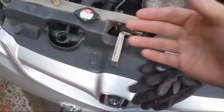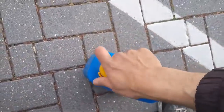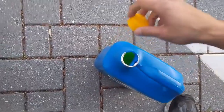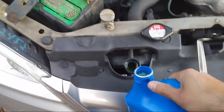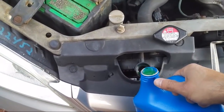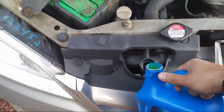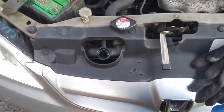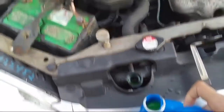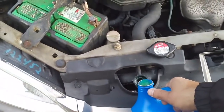I'm going to go ahead and put some more coolant in now. I wouldn't have to do this if I had a good spill-proof funnel, but I don't bother with that. There's already a good amount in there. Look how much more it can take — I thought it was full like five times by now. That's the coolant going down; some of it's burning off, but that's also the air bubbles coming out. Don't want to fill it up too much because it will rise and then spill — that can be a hazard for animals like pets walking through.